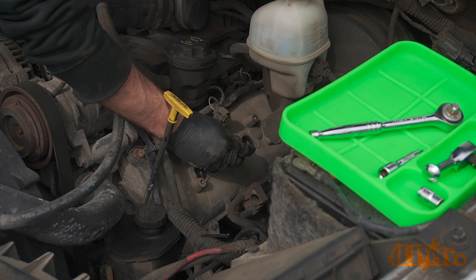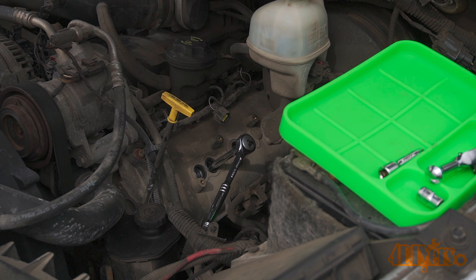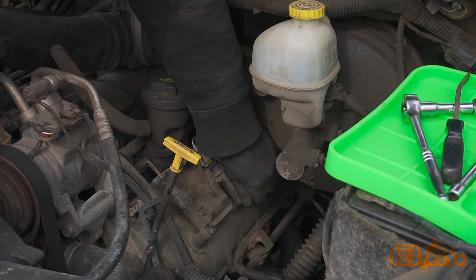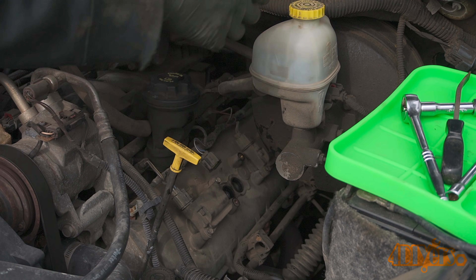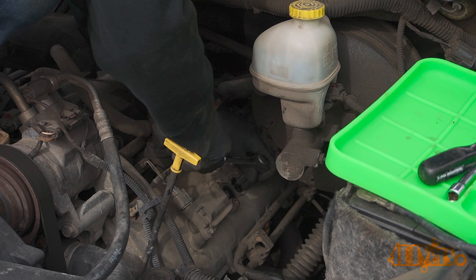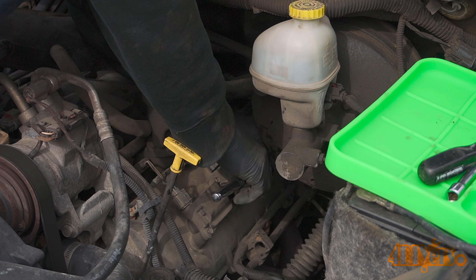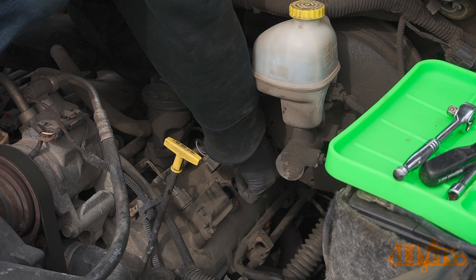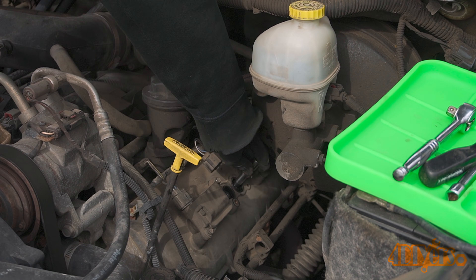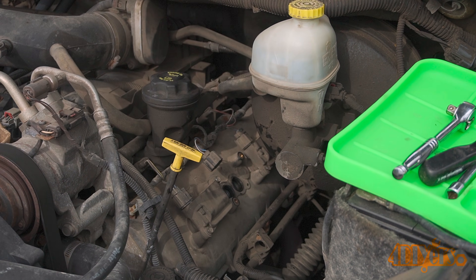The last three spark plugs on this side is where I started running into issues. In order to overcome this, I put the truck back together and took a further drive to get the engine up to operating temperature. Once back, I removed the coil packs and applied some penetrating oil around each spark plug. I then tried to loosen each of the spark plugs. Any oil around the spark plug will soak down into the threads. The plugs are also loosened and tightened, working them back and forth to help the oil into the threads and break away any debris. Do not force the plugs as you can damage the threads. If that's the case, you'll be required to install a helicoil. I do have a full in-depth video if you're seeking more information on how to work with seized spark plugs.